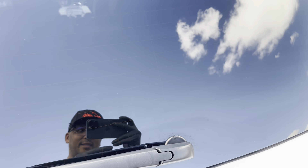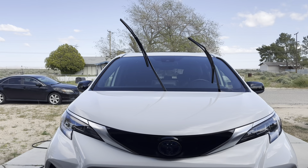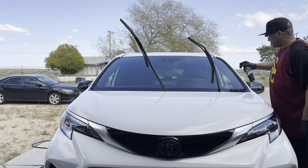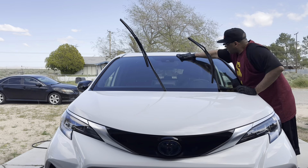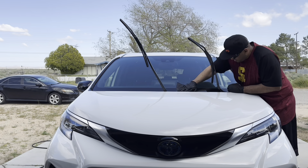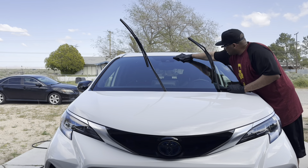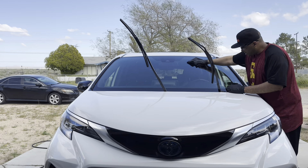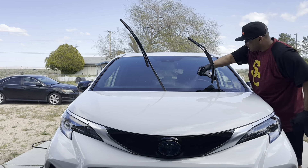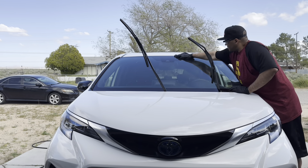We'll start with the back glass and get all the back glass and interior glass. Make sure you do the interior glass — if you're skipping the interior glass because you hate it, you're skipping a part of the process. The way I clean my glass I got from a Pan the Organizer video years ago. Grab your CarPro Clarify or whatever your window cleaning liquid of choice is and spray it on the window. Start at the edges of the window and work your way into the middle, then flip to a clean and dry side of your microfiber to buff off the product. Usually one pass is enough, but if you're not getting the desired cleanliness, you can always spray on more product and do it again until the glass is as clear and clean as you want it to be.